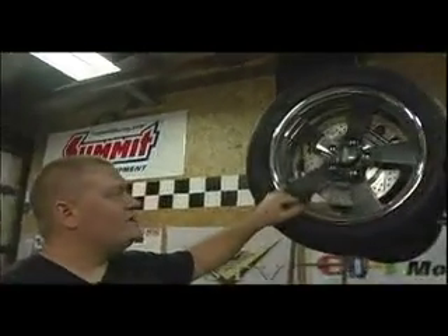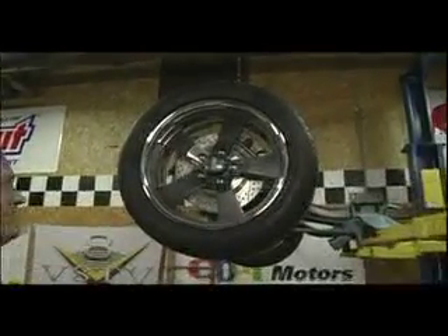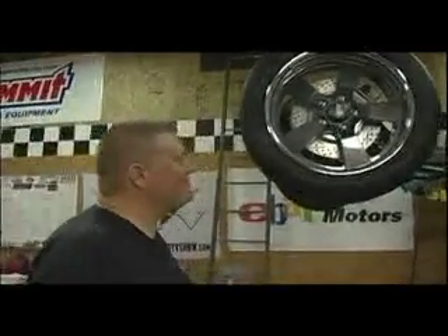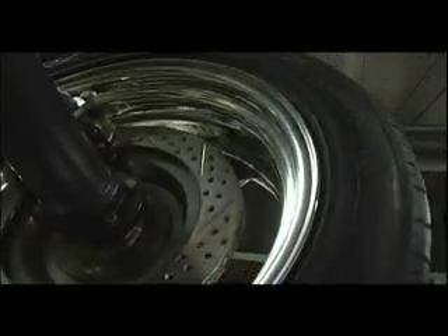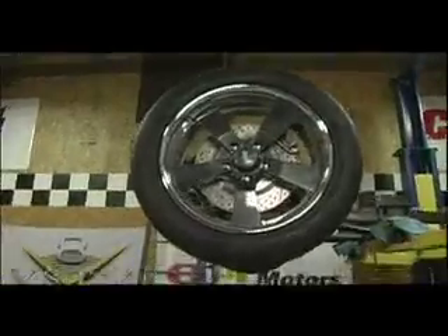We really like these because they've got a nice smooth lip on the outside and the center is powder coated in a gunmetal finish. There's no valve stem visible because it's hidden behind one of the spokes. Here's a tech tip: with a hidden valve stem, make sure it clears your brake rotor, because even though the wheels fit, you've got to make sure it won't smack into it. Ours cleared — completely by chance. The powder coated center on the wheel also just happens to match the chassis.